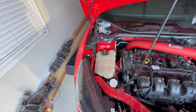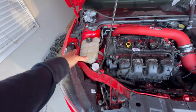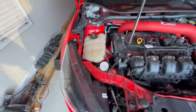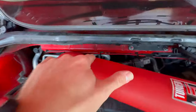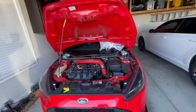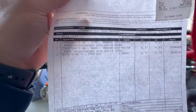I noticed something was up because probably about a couple weeks ago when I did my oil change, coolant was low — so I just refilled it, like okay maybe it evaporated or something. Then I checked it again and we're pretty darn low. I followed the pipe; the tubing comes over here, connects right here underneath, and goes back to the firewall — that is the problem right there. The heater hose connects to the heater core and that is leaking.